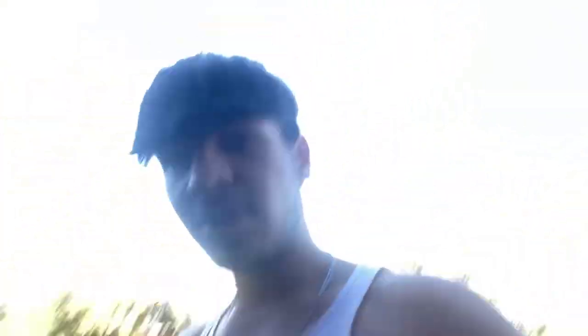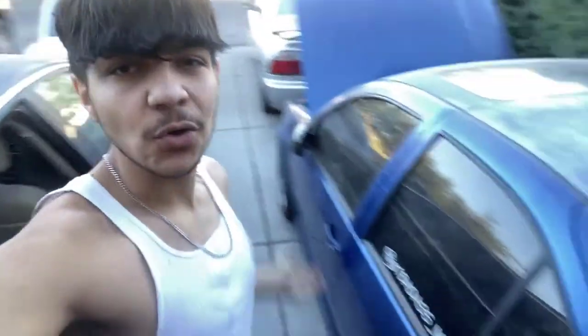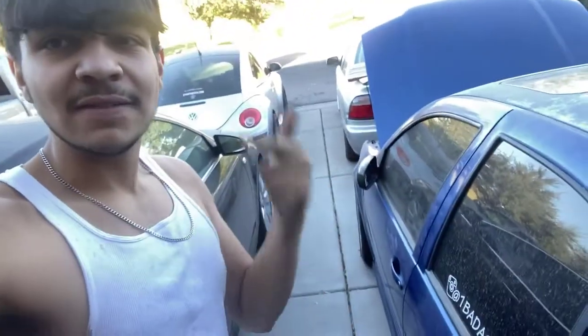Today I actually got a package that came in the mail. As you guys can see right here, as you guys can tell from the last video, I told you guys about this install. I was hoping for it to come in that day but it came in the next day, which is today. So now we are going to get this install started. I got to jack up the car, get the car lifted up, take the exhaust off, take the heat shield off, and then we can get the shift linkage out and replace it with a short shifter.